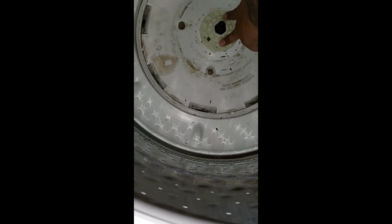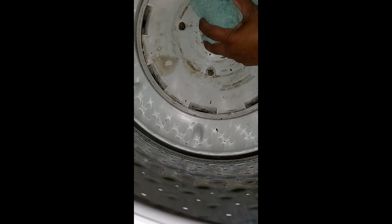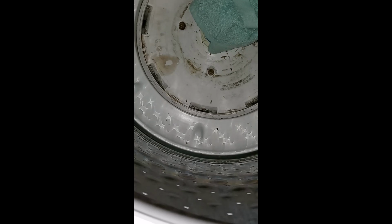So this thing had to line up perfectly with the bottom splines. There's a wider one there, and I had to have the screw holes open to get the other one in. You don't want to tap it down unevenly, so I found a cup that fit over it perfectly, and I just kind of dropped the hammer down on it so it'll come down nice and easy.